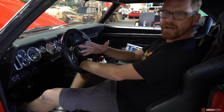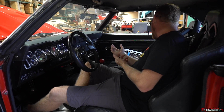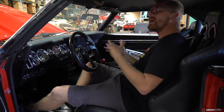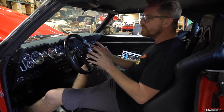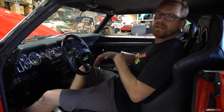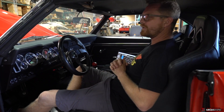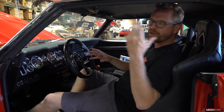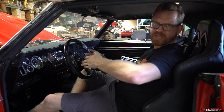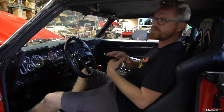On the very first pull it was 16.5 AFR, but now it looks like it's stabilized to 14, and it is already in closed loop right now so it's already trying to adjust. I'm definitely going to have to turn off the closed loop in a minute and get the raw table correct. You can hear it dancing and correcting a lot right now. As it comes up in temperature it's going to start stalling — I already experienced that when the car first came up to the shop. The guy was having to keep it revved, stalled out a lot of times just pulling in here.